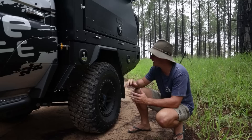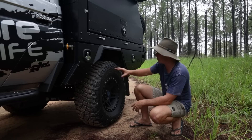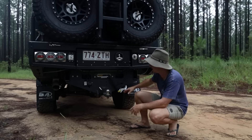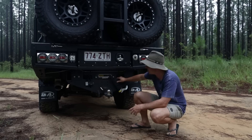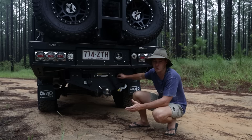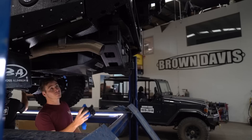We're going to get some in-car controls to adjust the airbag - that's one of the last things we haven't had time to do. When we're towing next year, we'll be able to put a little bit more PSI in those bags and everything's going to sit absolutely dead level. 3.5 stainless steel exhaust. This is the rear of the new chassis when we welded in the new chassis - big J-Max, solid. It gives you a tow point at the back and allows us to have a rear winch. We've got the rear winch cradle here - we're running the Bushranger Revo, 12,000 pound, she's an absolute stonker. Because the truck is going to be sitting that little bit heavier, it's probably going to come in at about 4 tonne fully loaded with all the gear, me and Jess. That's what I'm aiming for, so I should still have about 500 up my sleeve.